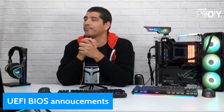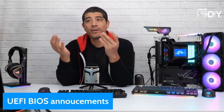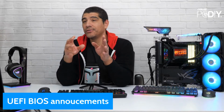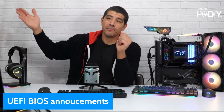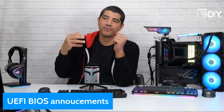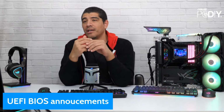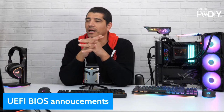Okay. Beyond that, there are also some updates to the older AM4 platform, which is already quite mature, and AM4 already got a wide level of updates not that long ago with the final release of the AGESA 1.2.0.7. That was a culminated build over literally months in terms of AMD transitioning from 1.2.0.3 to 4 to 5 to 6 to 7, and a lot of that was to help resolve USB interoperability issues, enhance them, and also fTPM stutter with the latest versions of Windows.